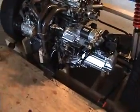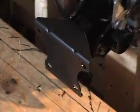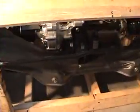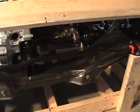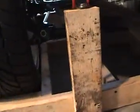I've got the starter mounted, got the clutch, and there is the rear bracket that mounts to the MR2's frame or unit body. I will be building my frame up against that bracket. Here is the driver-side bracket that will mount to the frame. Here is the rear bracket on the transmission — this is a motor mount; these are all motor mounts. That's the rear motor mount — it attaches to the rear cross member, which attaches to all the suspension components underneath, all of the control arms and linkages.